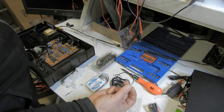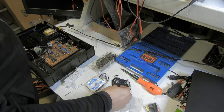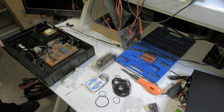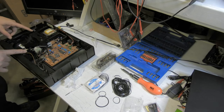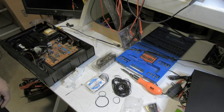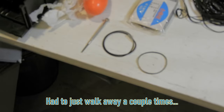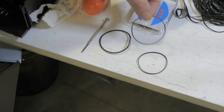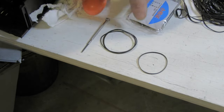I'm going to go a little bit tighter than the original. This is the original belt, which I taped together with a little bit of tape just to get an idea how big it would be. I'm going to find a belt out of this kit that fits. I have to go through the trouble of redoing the whole disassembly again — taking the front panel loose and a lot of other mounting bolts loose so I can get the drive apart and get the belt in. Here's the original belt taped together, and here's the belt I was using — maybe slightly longer, so that was doomed to fail.